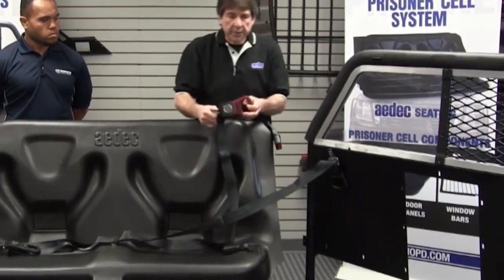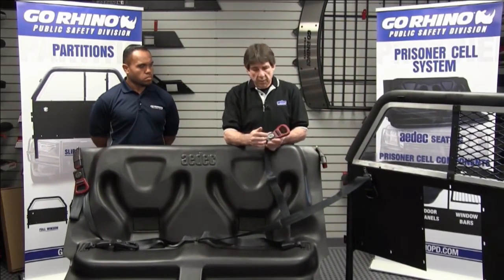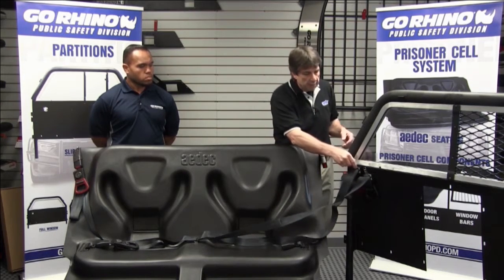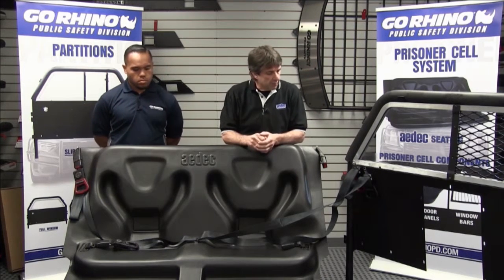When you get these, there will be a small hole in the handle retainer. We're going to provide you with a magnet, an 8x1/2 screw — just don't use a screw gun, put it in by hand. It just snugly goes into place. With a screw gun you risk going too hard and stripping it out, which is obviously not a good thing.